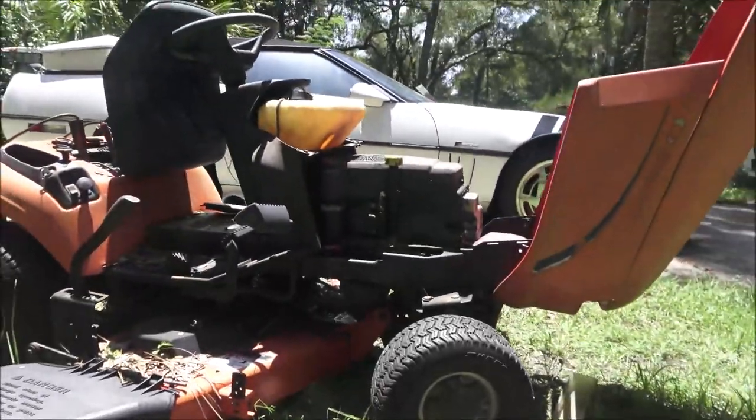Cleaned that out. And when I cleaned that solenoid out, there must have been a piece in it, because when I pulled that jet back off, that little tiny jet had a piece of cotton in there. So I started it up, and it seems to be running all right now. I'm going to start it up again. So watch your ears, guys.